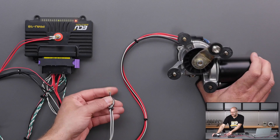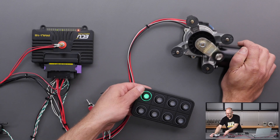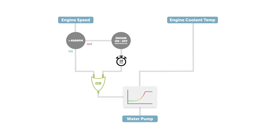This course will teach you how to choose a PMU system that will work for your project. You will learn about setting up communication between the engine management systems, switches and keypads. You'll learn about more advanced control strategies like using pulse width modulated outputs to control motors such as an electric cooling fan or water pump.